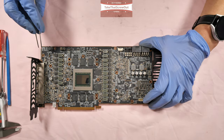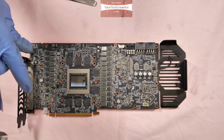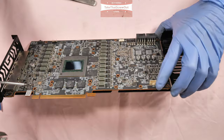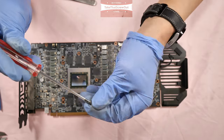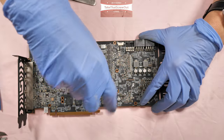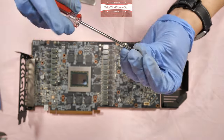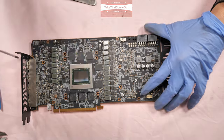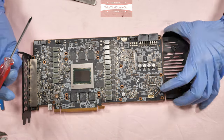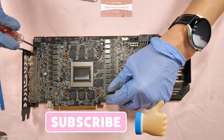Make sure the 5 screw holes are aligned correctly before you screw in. When you put the screw in, make sure it is not over-tightened, just a snug fit. Plastic could easily break.